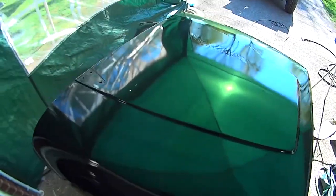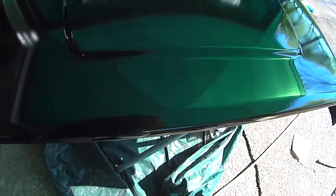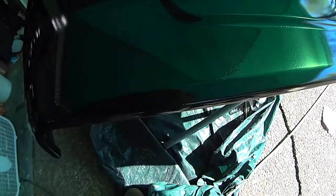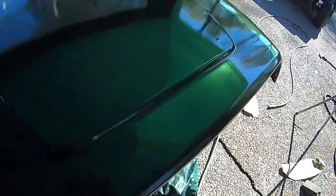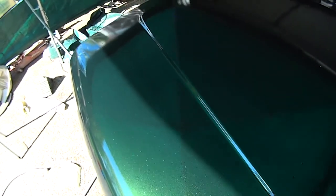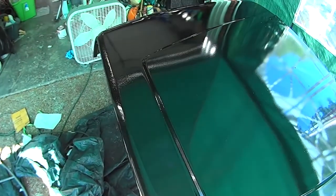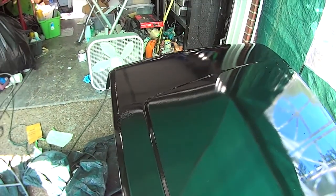The hood looks pretty good. There was some funkiness right at the end — I don't know what it was. It looked like it just blapped on a bunch of clear, which is going to be okay. I'm hoping it'll just sand out and then we can buff it. We'll know in a day or two whether that's going to sand out okay, but from the looks of it, it looks like it is going to be fine. Just sand it down — the whole hood will be sanded down and then buffed. The green metallic looks awesome. The issue wasn't in the green base coat, it was in the clear. I put in way extra clear, and that may be part of the reason it mottled up in one spot.